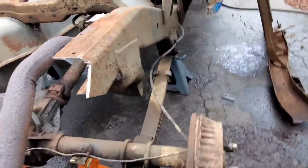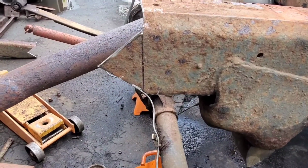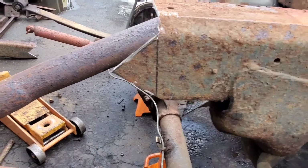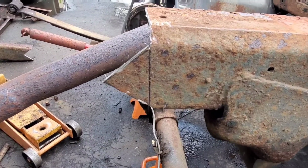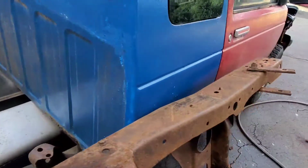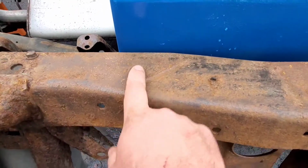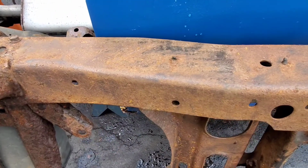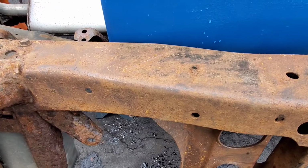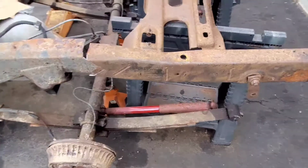than the top, and I have this pointed part here to give me some more surface area to weld to. Because the more of an angle you put when you weld it, the more surface area there is of weld, which will give you a lot more strength that way. So now we get to prep this guy. We got to cut it somewhere right around here and get it mated up there and lined up. I got a bunch of measurements to go off of to do it, and then we'll weld it on.